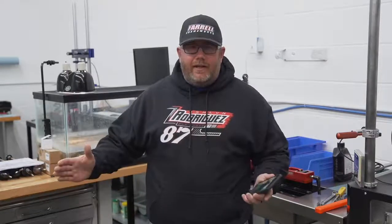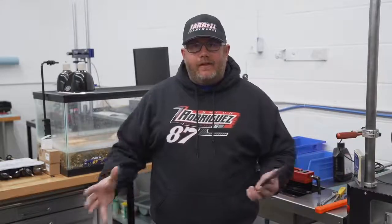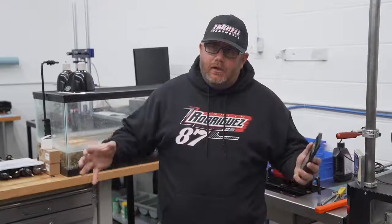So if you have your dyno sheets laid out and you've got a right front that's 87 and another that's 83, I don't really feel like that's a big enough difference that somebody's going to feel a difference. When we're building shocks here, we're trying to build them absolutely as close as possible — certainly closer than 20% when matching like shocks. But that's about the change a driver should feel.